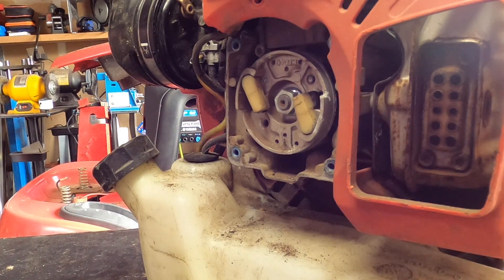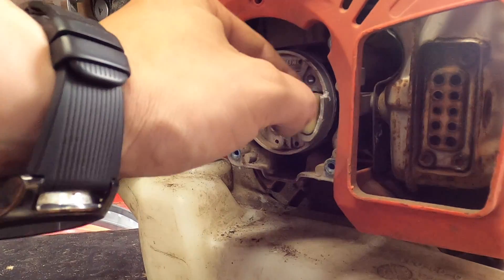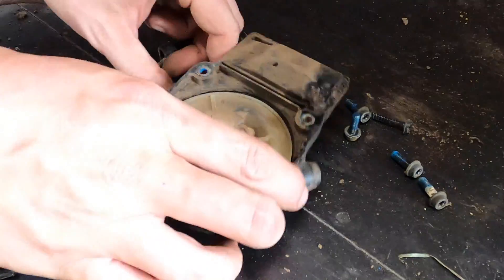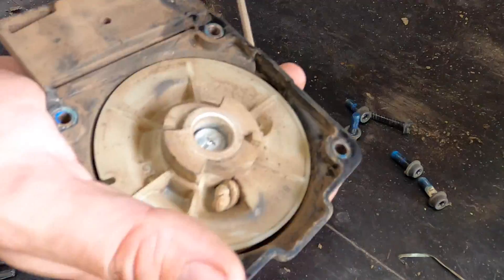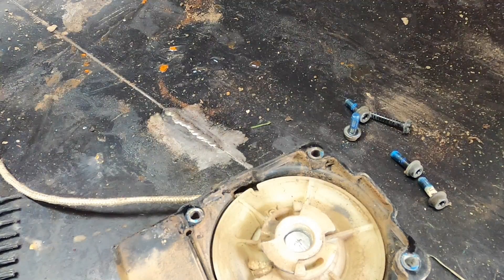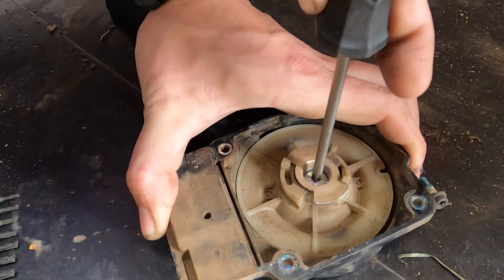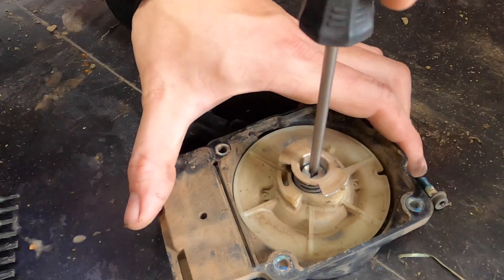This is one that I personally own too — not this exact one, but this model. I personally think this is a great blower. All that seems to be in good working order. When you pull on the cord it does retract, however it's just not all the way. So this spring is either needing some lubrication or I suppose it could be broken, but I don't think so.